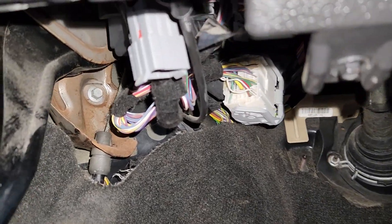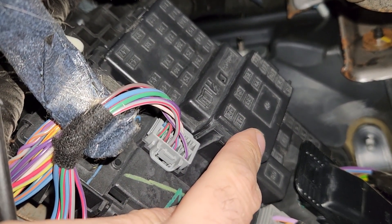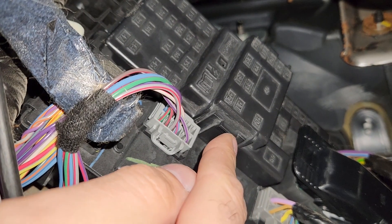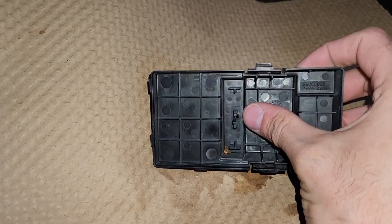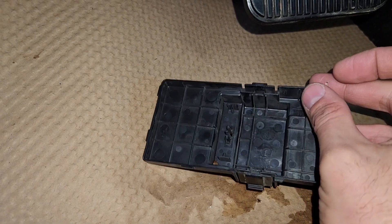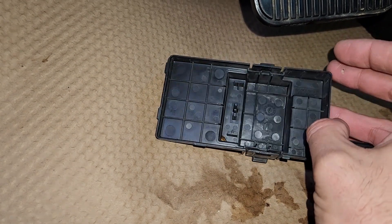I'll turn the flash on my phone and try to squeeze it in. This right here is the fuse box cover — you can see on top of it there is a small fuse diagram. To remove the cover you'll have two black tabs, one on each side, so press them together and lift the cover off. On the back side of the cover there is supposed to be a fuse puller, but this car is missing it. Yours will have a small white fuse puller which you can use to remove any of the fuses. If you don't have it, you can use something like small pliers or anything handy.